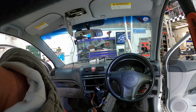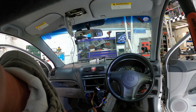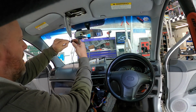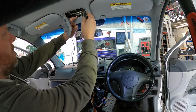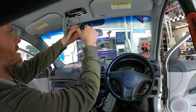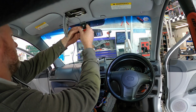And we need, there's the little sticky pad for the mic. So he lost it. Yes. Right, we add on our own sticky pad because I can't find the customer's. He's unboxed it and it's not present. So a couple of things to note. When you put the microphone up here in the center, watch where you're putting the screws back in for the light unit. You don't want to mount the microphone up here and then screw through the cable, because that would just be stupid. I've seen it done many a time.